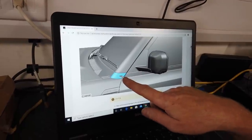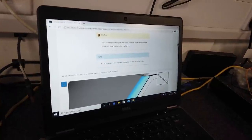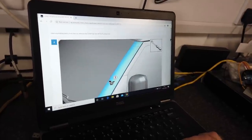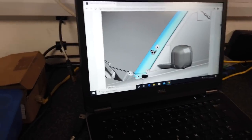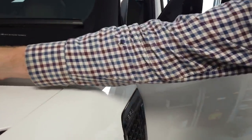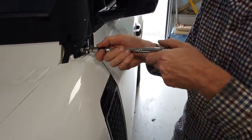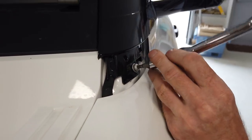What we're going to do now — we did this when we wrapped our A-pillars — we're going to take out that little bit at the bottom. Caution: to avoid damage to vehicle paintwork, retain that. Let's do that. We're going to pull this clip off — it pulls off from the back there — and we've got to wiggle that out. Then there's a Torx there, so let me go and get a Torx. It's a T27 — which is a weird one.